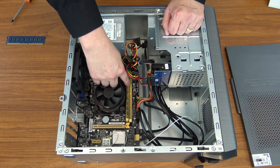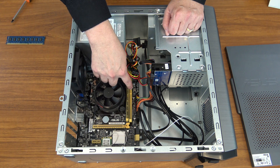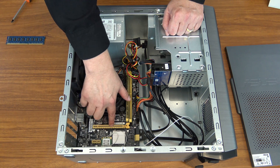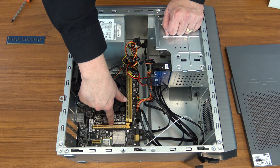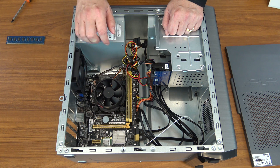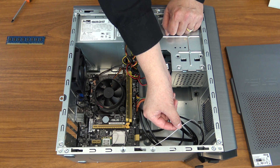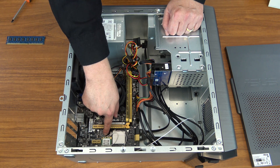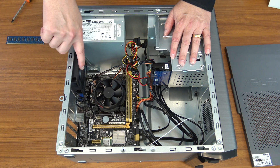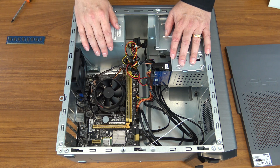This is your eight gigabytes of system RAM with one open slot. I do have a separate video showing how to upgrade the RAM if you're interested. This is our graphics slot where we'll be installing the graphics card today. And then this chip right here is our AC Wi-Fi — if you use Wi-Fi to get on the internet, that's the chip that's actually doing it. These white cables running to the front are the antenna to that chip, and they actually run all the way up the front giving us great reception.